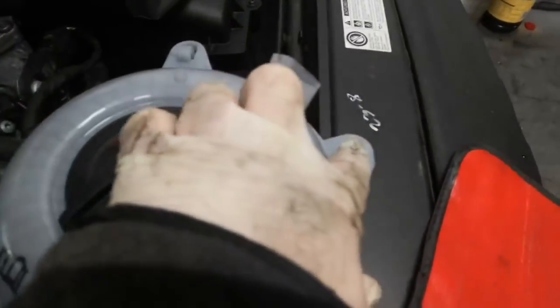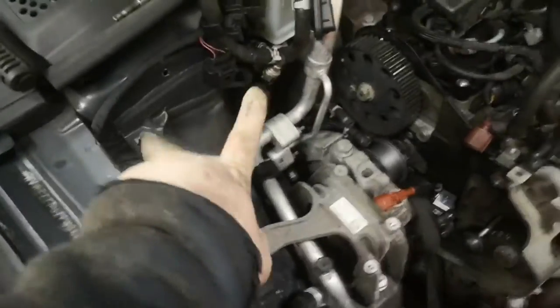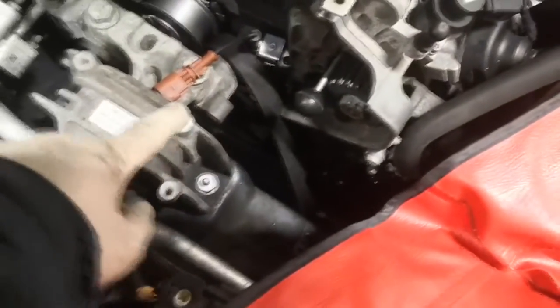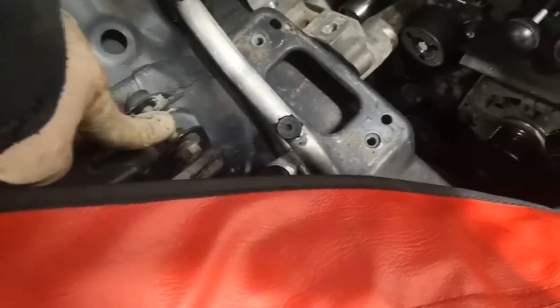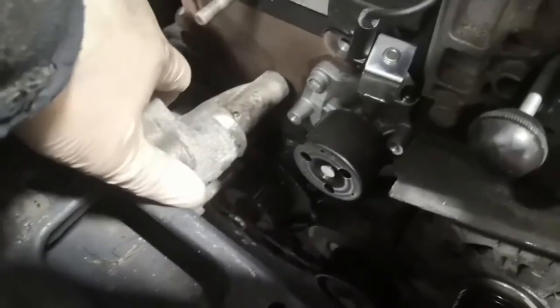I'm taking off the engine mount. I've had to move the coolant bottle — it's just these two little clips here, then it unclips from those two holes and I just lifted it up out of the way. The fuel filter is two 10mm bolts and a 10mm nut which you'll need an extension to get to, and that gives loads more room. The engine mount is just two bolts here, two bolts on that, and then this bolt here which you don't have to take out — you can just lift it up and swivel it off. Then I jacked the engine up to get to this bolt, which is a 16 — all three of them are 16s. The other two you do from underneath. Then once done, I moved it down and out of the way to get the belt off and dropped it down so I could get the tensioner off.